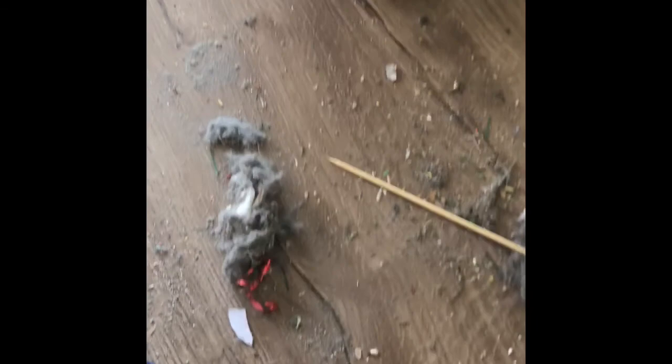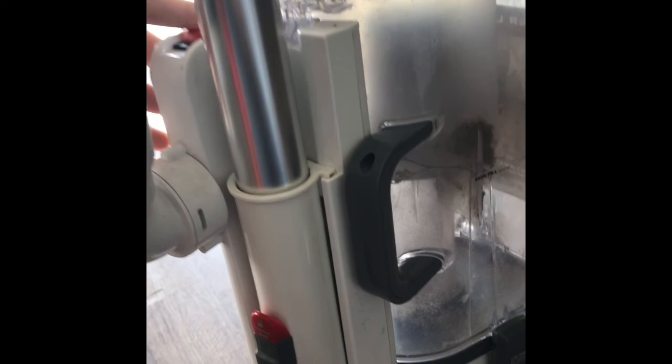So now I've reassembled it. I checked if there was a clog here, and it looks like there was something in this hose area. I can see it right here. I know it's gross, but proof I vacuum. So let's turn it on and see if we get a clogging noise. There's a little valve here, so I'm going to mess with that. I still hear something, so it tells me there's still a clog in there.